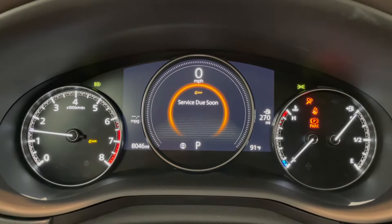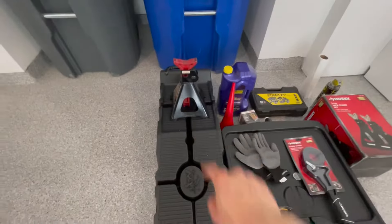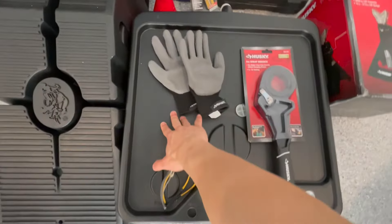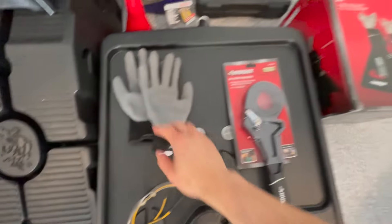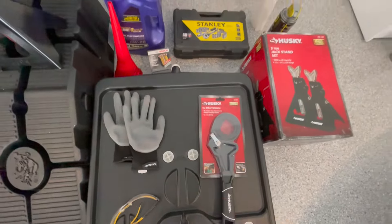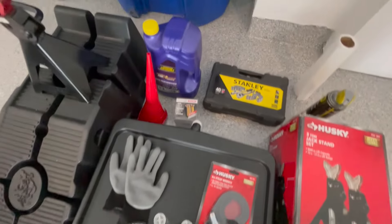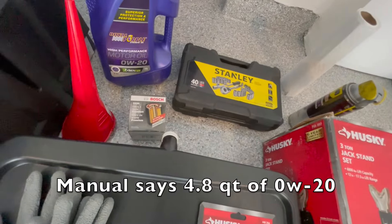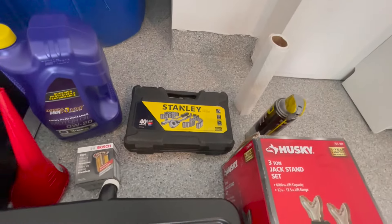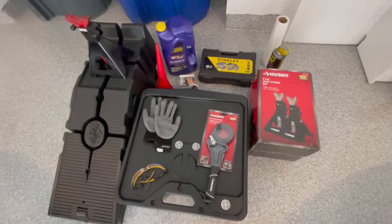And there's the service light. Let's grab the things we need: my ramps, jack stand — I somehow lost one jack stand, so I bought two more. An oil collection tub, safety glasses, gloves, and this thing for taking off the oil filter. There are better tools for this but I couldn't find mine and Home Depot ran out, so I got this instead. Oil — in this case 0w20 — oil filter, funnel, sockets and screwdrivers. Some degreaser, paper towels or shop towels, and we are ready to rock.